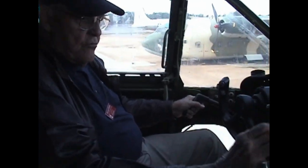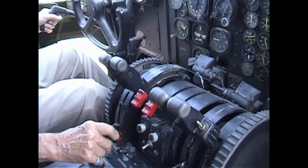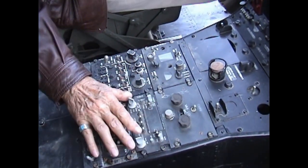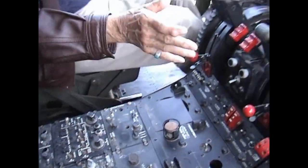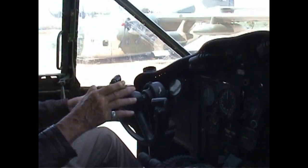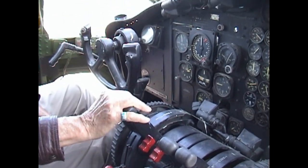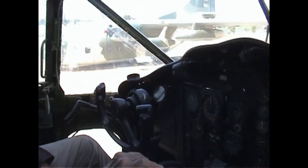When we do take off, here are the throttles for the pilot, and the co-pilot's are here. We make sure our mixture is on and the props are set by these levers. We have radio compartments here to ensure proper ground and air control. Then we line up, push the throttles forward, and guide with the nose wheel steering until airborne. Then you use your rudder pedals to control the aircraft, climb up, level off, throttle back, and get it trimmed up for flight.